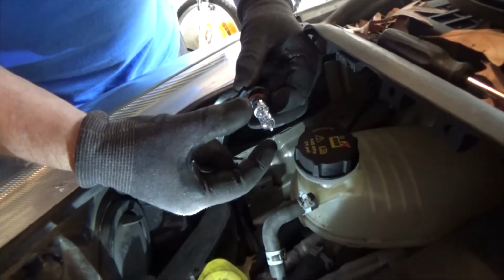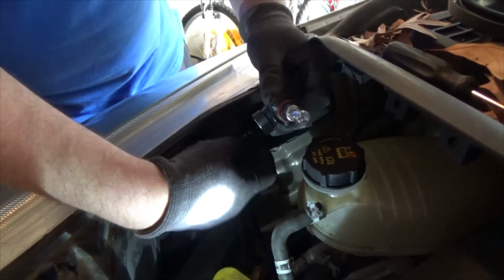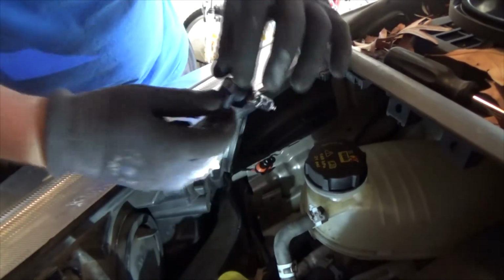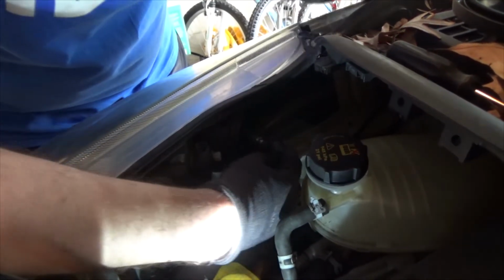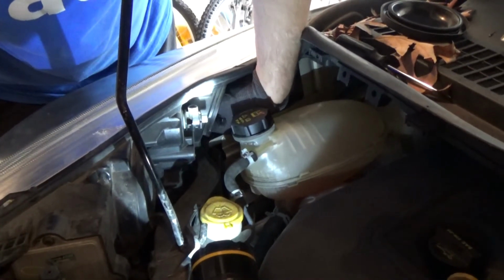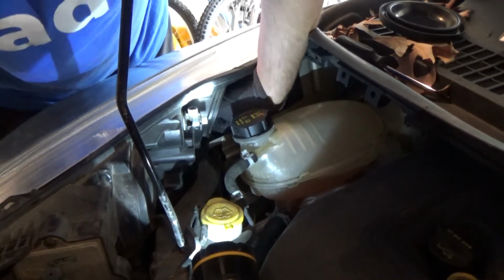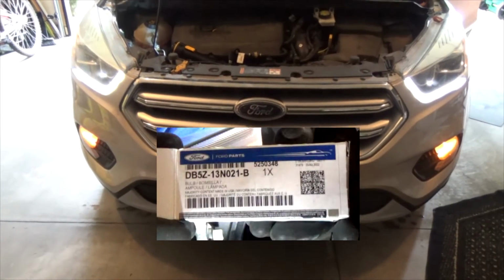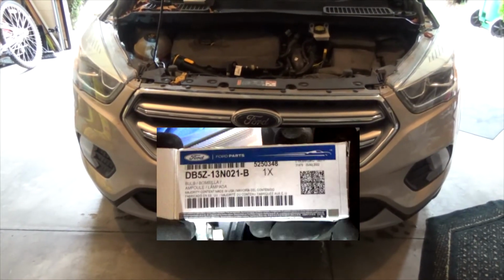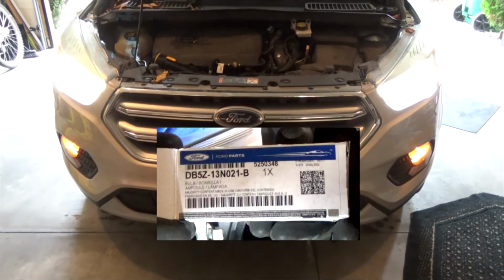Never touch the actual bulb with your fingers, because you're gonna have either dust or grease on your fingers. So just keep it like that and retrace your steps. Click, suck it in, and you stick it in the hole. The tricky part is you gotta do it blindly over here. So before covering everything up, double check that the new light bulb is good. There you go.